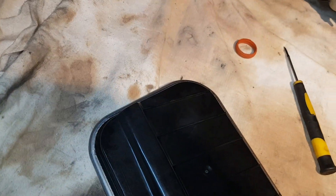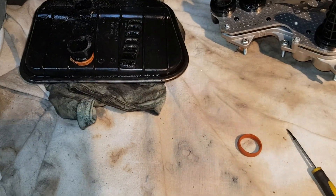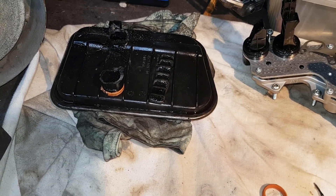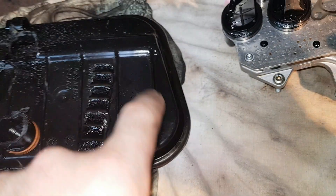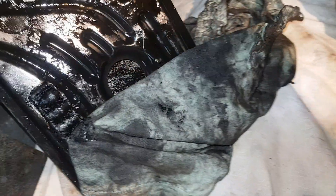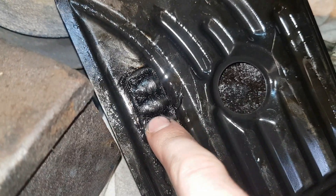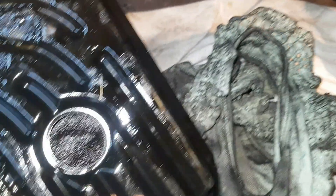I'm really curious because this gearbox ran for exactly 80,000 miles before it first broke down, without an oil change. I'm really curious how bad it is inside. Obviously there are loads of plastic bits inside, but once I take it apart we'll have a look at this part of the filter - how bad it is. Looking at the magnets - they've got loads and loads of metal filings. Yeah, that's all metal, although it's nice and spongy, but that's all metal.